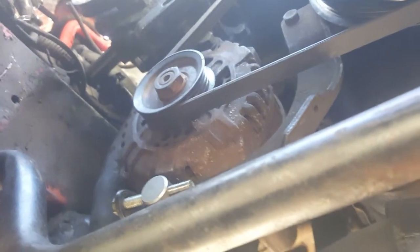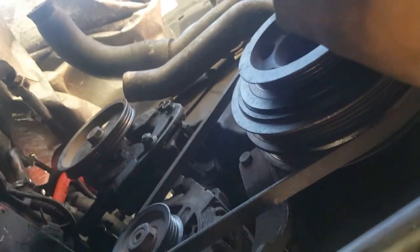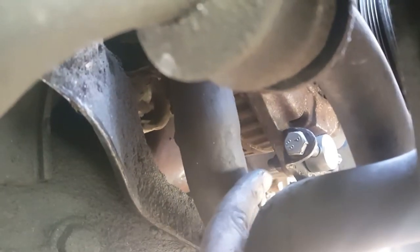The final belt is your alternator belt, and this is going to be your favorite because the adjuster is pretty much sticking right out. Sometimes this belt gets a little loose — you'll turn on the car in the morning and hear some squeaking that then goes away. That's usually this belt. The cool thing is you don't have to take out the fan, radiator, or the other belts for this one. Just lift the car up and there it is — you can usually reach it with just a socket and ratchet.